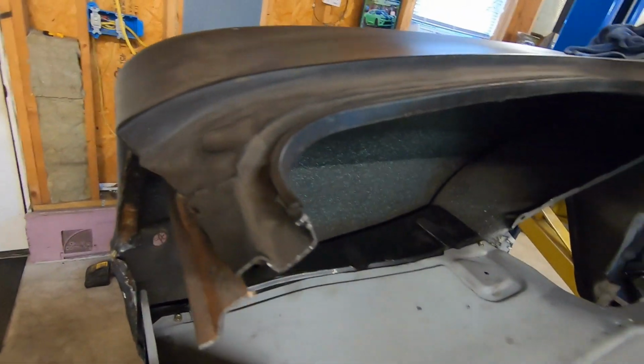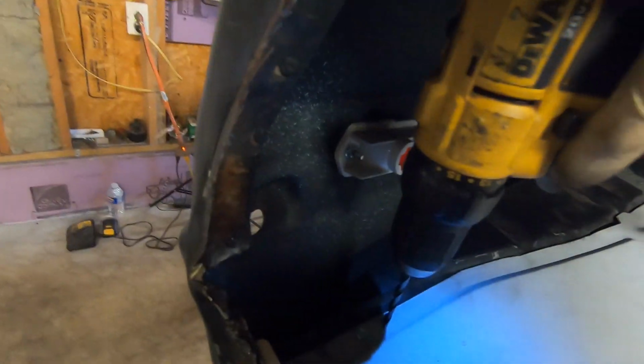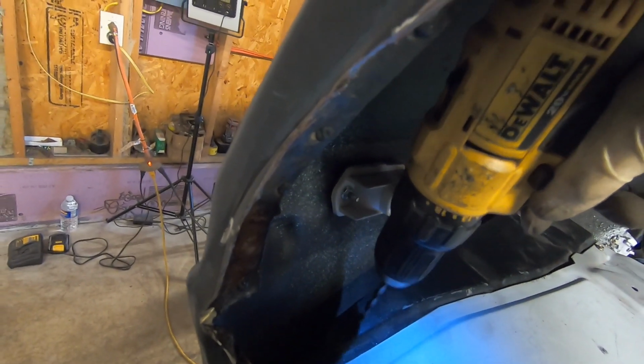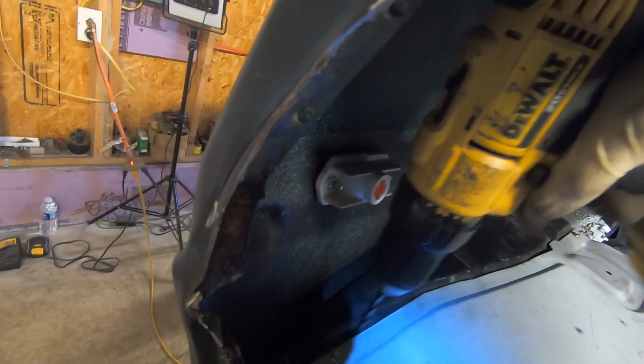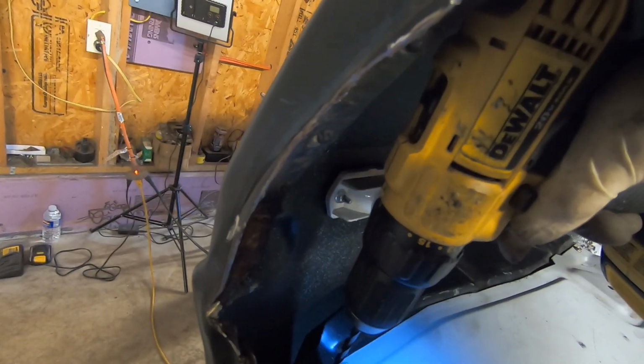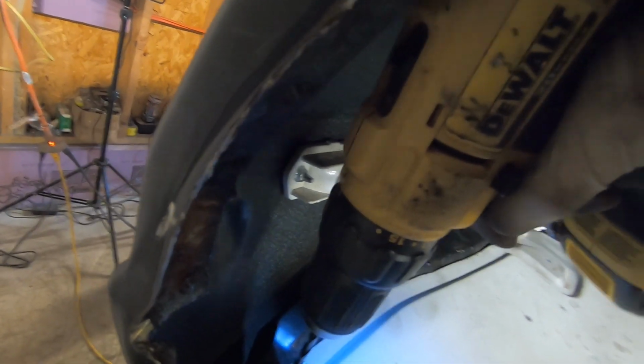So I got two drills, one with a bigger bit, one with a smaller bit. We're going to drill through just the top layer here into the second layer and clean up the second layer. So we know that's a nice fit there. We have a screw there. We'll go right in between here. I'll probably do 2 spot welds in between, or plug welds.